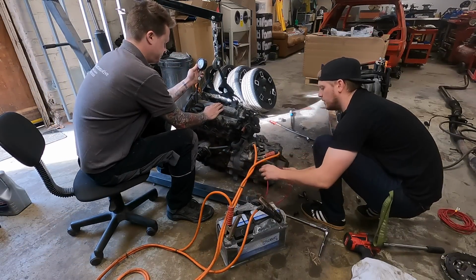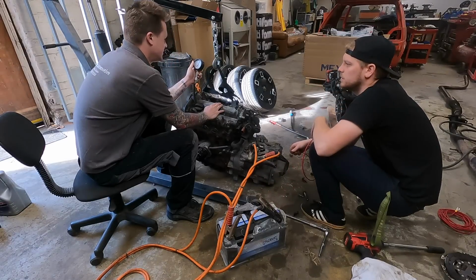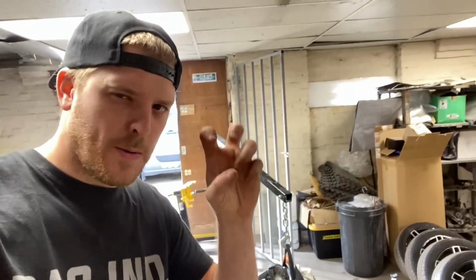180 psi. Okay, so that should be good. So that is good. The old engine, we were getting a reading on 3 cylinders of 150. Cylinder 2 was 90, and then we got it to about 100. But the new engine is 180 to 182 on all 4 cylinders, which is really, really good compression and what we wanted to see with the engine.